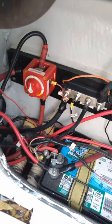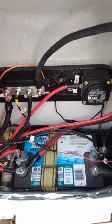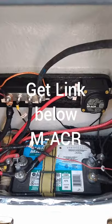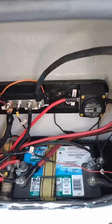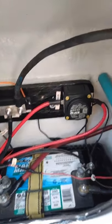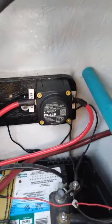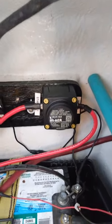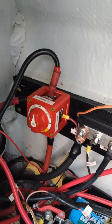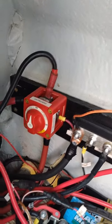For the most part while you're out trolling, playing the radio, or using lights or anything else on a 12-volt system, you're separating it from the starting battery. The good thing about it is with this MACR — you see that little black box there — that's like a mini computer, awesome thing to have. And this is your off and on switch. It's a little different from the regular dual battery switch, which looks like that red and white item there.